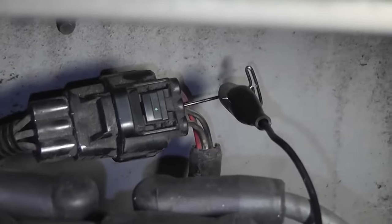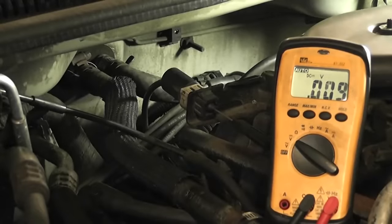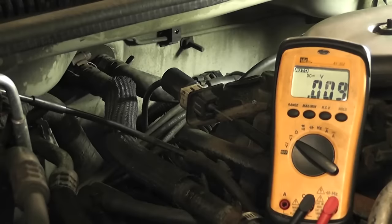So in the sensor ground circuit now, and this is going to be a ground-to-ground voltage drop test. We have nine millivolts — that's good. What we look for generally is less than 100 millivolts on a sensor ground. One of the things you want to understand though, when you do sensor ground testing in a cranking condition, you are going to have higher voltage during a crank than with the engine running or with just the key on, engine off. That's because the starter draws a huge amount of current flow and loads the block with a lot of current and energy. So I'm okay with 200 to 300 millivolts on an initial crank.